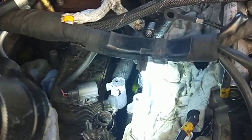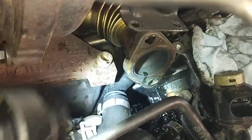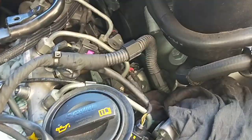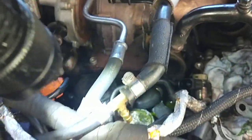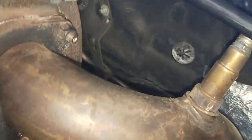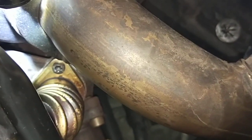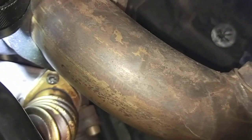When you put it on, you've got to use the clamp type. The clamp type hose clamp is like that one there — it's clamped on so you don't have to worry about taking it off. The EGR cooler exhaust bolts are all damaged, see that one there, so it's really hard to do my job when things are damaged from before. Luckily I got it out.